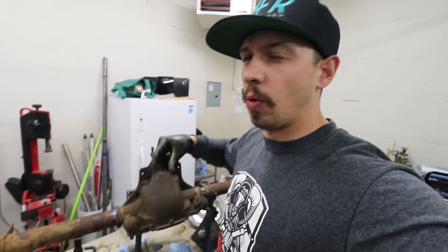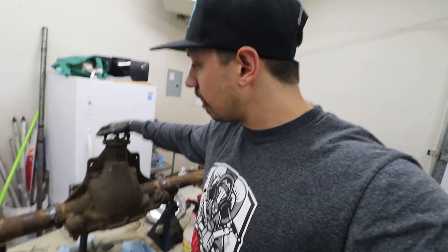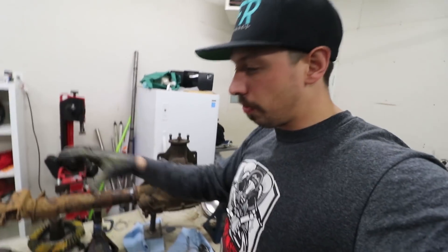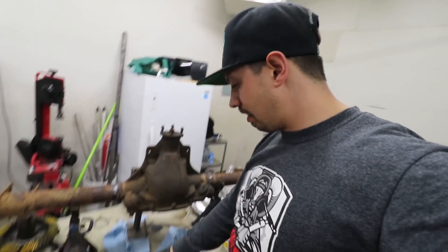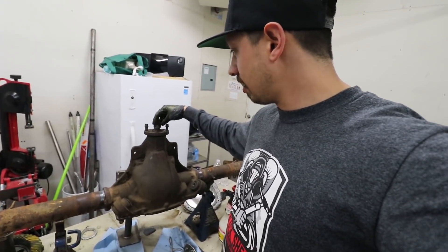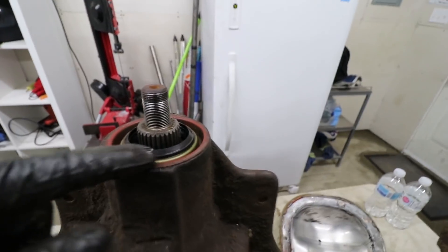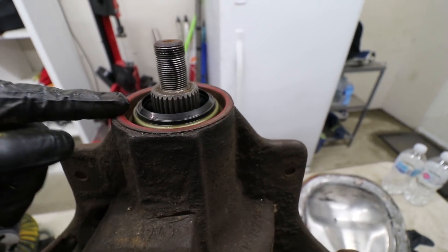I can't get the pattern perfectly the way I want it — it's kind of like heel on one side, toe on the other. So what I'm going to do is start fresh. I'm going to take the pinion out. I do have a dummy bearing, I have a spare bearing, I have all the pieces I need to change the pinion depth. I just didn't want to do it, so we're going to do it anyways. And that's the wrong size. Good start, Kyle. Yeah, it's kind of sad — you can tell that it was a new hole set up. This is seals brand new as well.